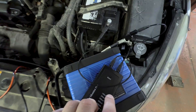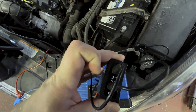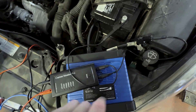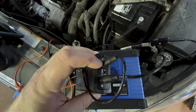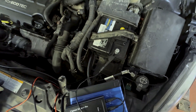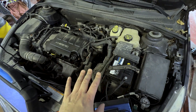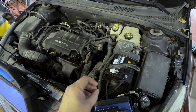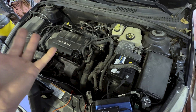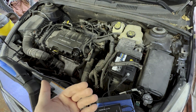On the other side of the Current Monitor Pro, if you look right here, the positive side is going to the battery negative cable itself, and the negative side right here is going directly to the battery negative terminal. There are a number of different conditions you have to satisfy to set up the vehicle properly to do a draw test, which we will put a slide up on the screen with those basic overall conditions you have to satisfy in order to do a proper draw test.